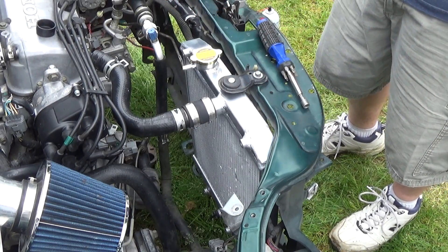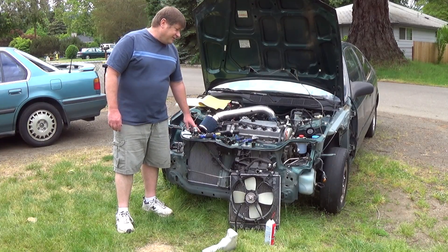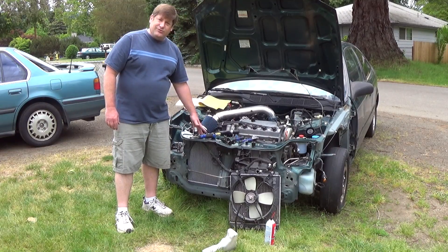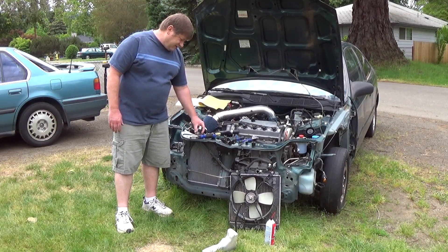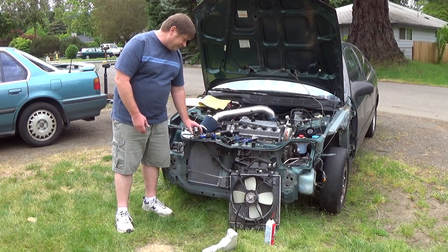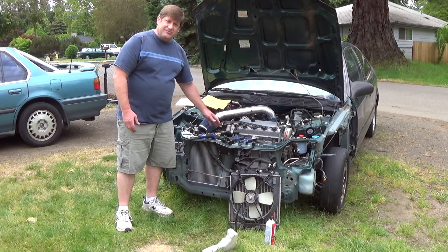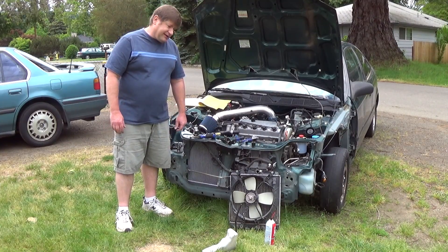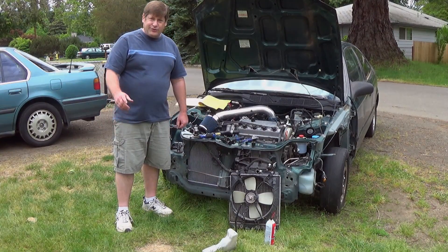Then you've got to deal with putting your coolant back in. So now when you get your dual core all-aluminum radiator for your D-Series engine off of eBay and you realize, 'Oh, this is really for a B-Series' — which it didn't tell you — now you have the knowledge and ability to use your adapters to get this hooked up and still use your original OEM hoses. Hopefully this video helped somebody out. If you like this video, give me a thumbs up, and if you subscribe you'll get more videos as they come out. Thank you for watching.